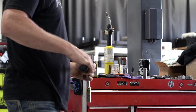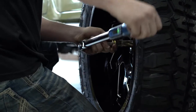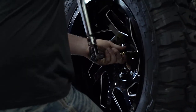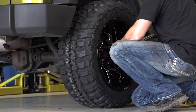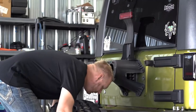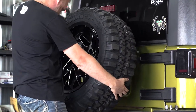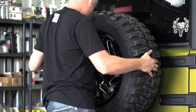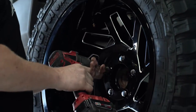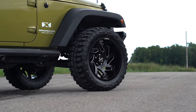If you're going to be doing this yourself, you'll need to figure out the proper torque specs for your wheels on your vehicle. Normal numbers will range from 80 to 120 foot-pounds, completely dependent on whether it's a car or truck, weight, etc. A simple Google search or checking your owner's manual should show you the numbers you need. Once you find them, you can either purchase or rent a torque wrench that meets your requirements. As always, tighten the lug nuts in a star fashion to ensure your wheels tighten evenly around the hub. And you're ready to roll!